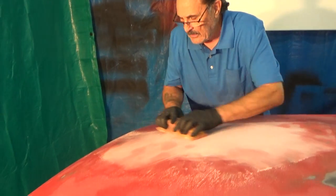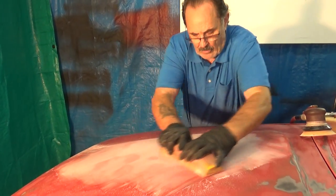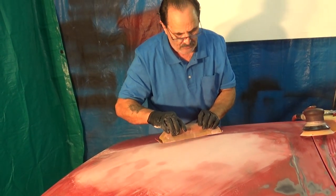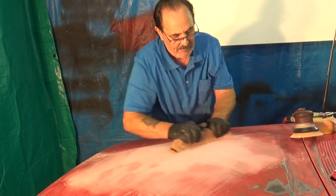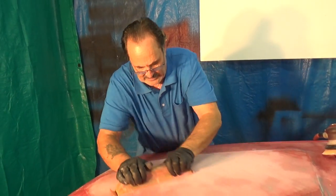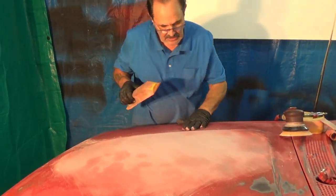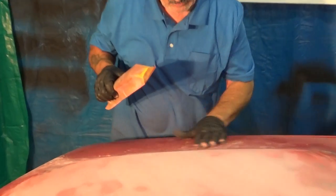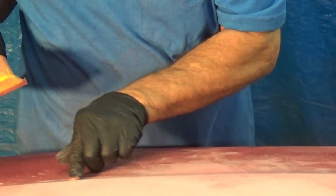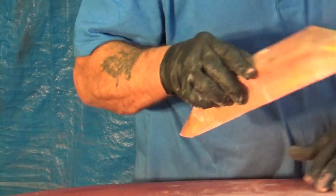I want to go at this angle and cover this area, then lift it up. I don't want to swirl it around and drag the sandpaper — do not do that. Pick it up. Don't be lazy — pick it up and go back the other direction. I've gone well over the area past where I was working, and right here is a contour line that juts up and then down, so I don't want to go over that so much that I wear the paint off that high-low spot. Some of them you have to, like I have here, but that will get this surface the way you want it.